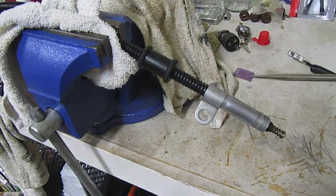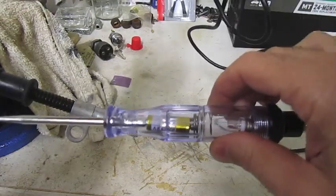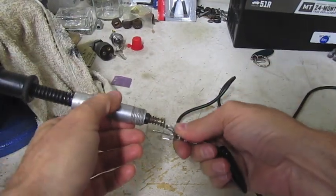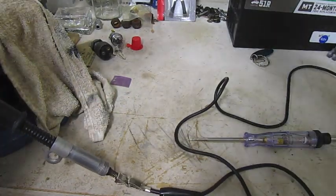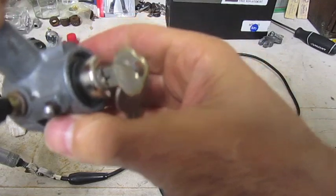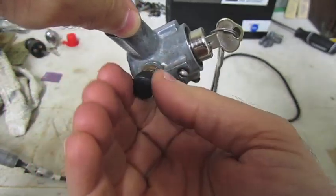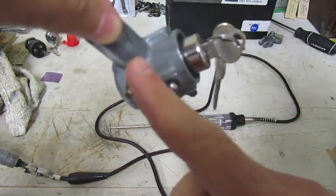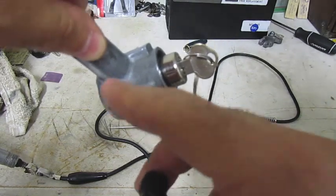I'm using my light switch test. This is a test light — it's got a little battery in there, so it gives me a little current. Basically, when the light lights up, you have a connection. I'm going to put one end here on this end plunger with this little alligator clip, put that on right there. The other end is the switch. The first test you do is this little tip that you screw off here — this is like a brass terminal, a little brass screw. This is the red wire when it comes from the coil into your dash to the switch here; it connects there.